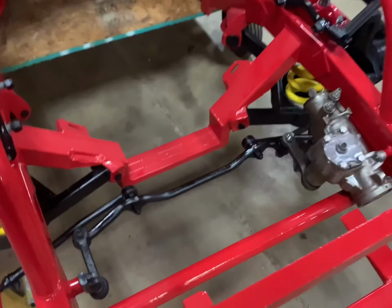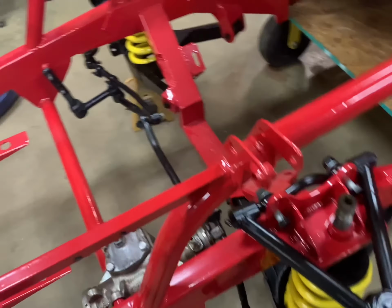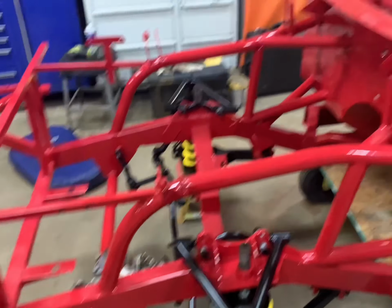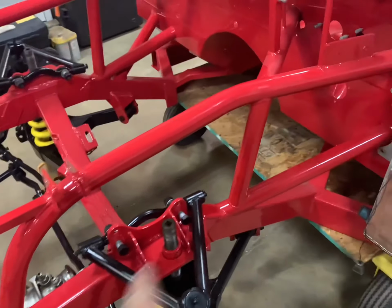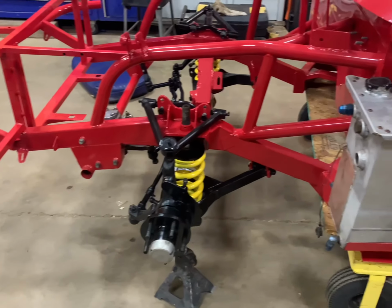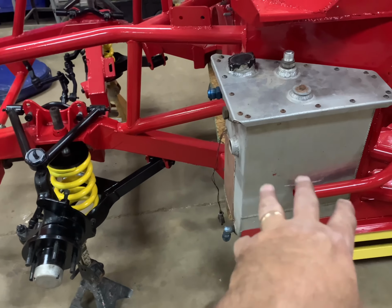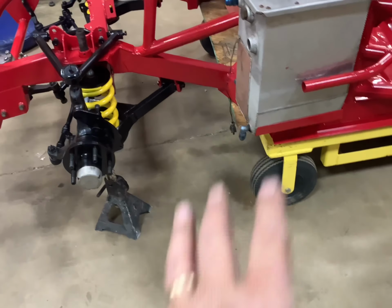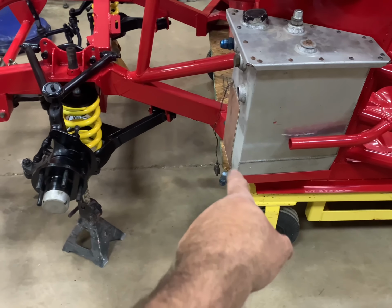Alrighty then. Now there is a tie rod and drag link and idler arm and pitman arm all installed. Man, that was a job. That's what I've been dreading the most, to be honest with you. And we got the steering shaft over there drying. That's going to be the next victim. Run it through the steering, up through the firewall here. I got to come up with some new bolts for that. But I'm also going to cut a piece of rubber to put up under this tank, and once we get the rubber under the tank, we'll go ahead and mount it permanently. Also going to put a flat plug in there. Remember that oil tank was mounted inside the car, and that's why they had to drain it through the floor pan. Well, now we've got access to it. We'll just put a flat plug in there now.